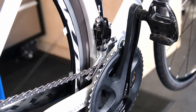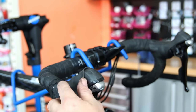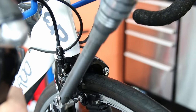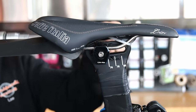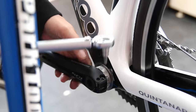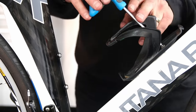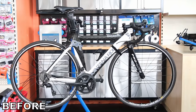The lovely thing about Shimano — 105, Ultegra, Dura-Ace — they're great groupsets that adjust up nicely. Now we're breezing through with the torque wrench, always going front to back: handlebars, stem, handlebar shifters. Even this top cap with the Ironman engraved design for this rider — we aligned it perfectly; it was slightly off-center when the bike came in. Even the cable pinch bolts have a torque setting — over-tighten and you'll fray the cable strands; under-tighten and it can come loose. Every pinch bolt has a torque wrench setting.